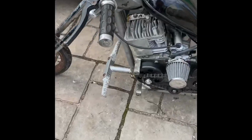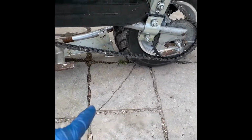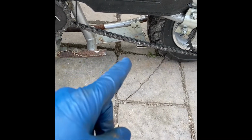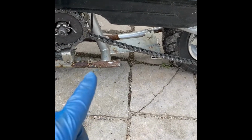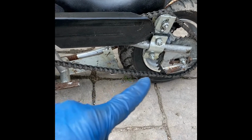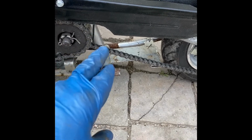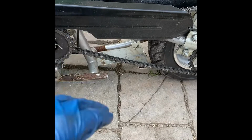And I figured I'd do a little bit of a tech update. So I finished up the jack shaft. I also had cut off a bottom piece to that, what would have been a swing arm if this had suspension, but that bottom piece is no longer going to be there. Now it is strong enough to hold itself together the way it is. The reason is that reinforcement piece in the middle, and the other side is completely rigid like it was before.